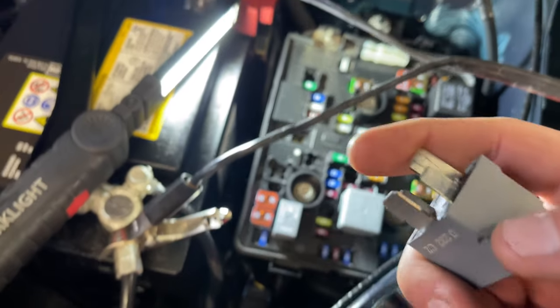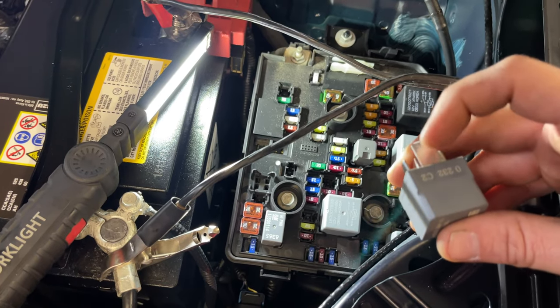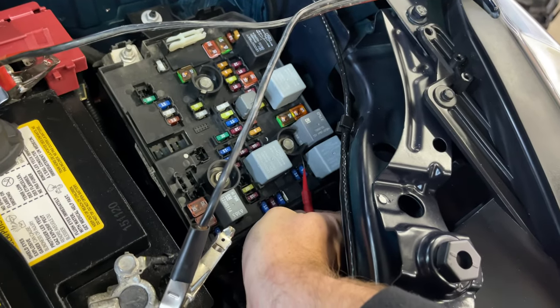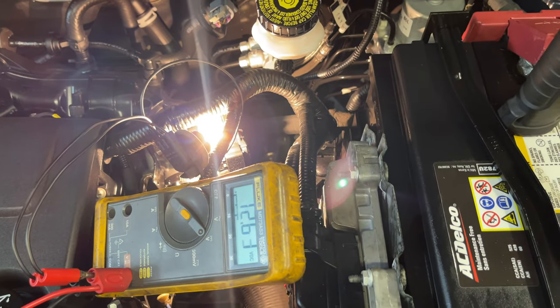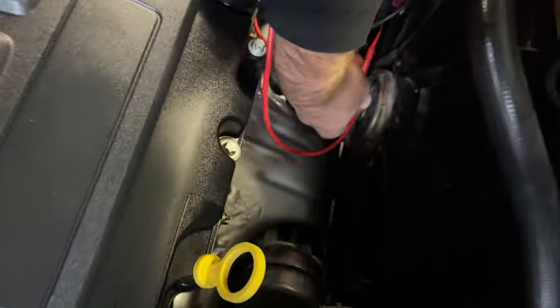What I'm going to do now is, since I know this is the input and this is the output, I'm going to stick this back in but get in there with a back probe and touch this to see if we still have a voltage drop. On the scan tool I've got the relays commanded on. As you can see, we've got good power coming through the relay. Now let's just double check it back down here.